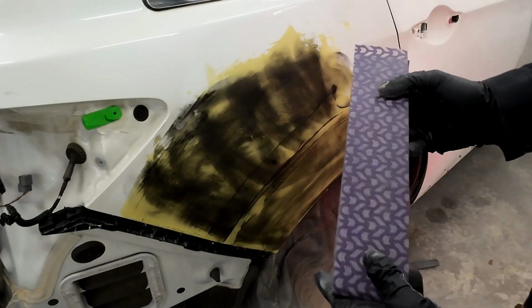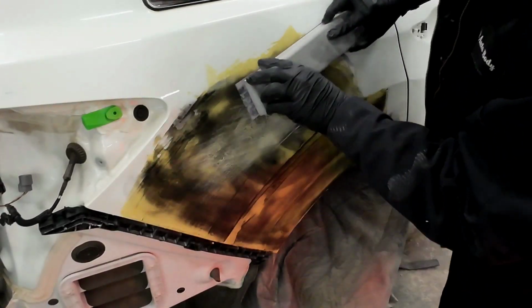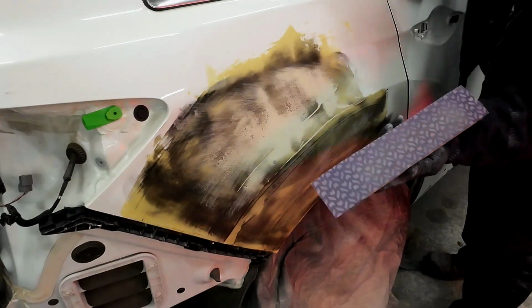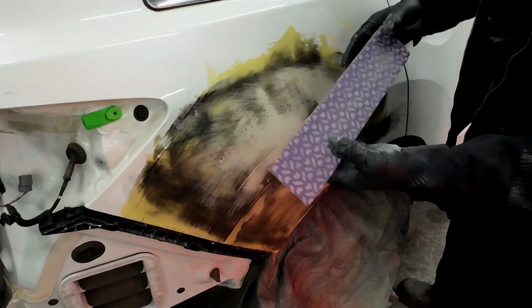Cost effective too, because even though it's a little bit more expensive, it's going to last a heck of a lot longer. I like to shape with 80 grit. You could shape with 36 grit. It's a coarser paper. It's going to cut it quicker, but it leaves very deep scratches that you have to remove. So my progression is 80 grit, 180, 320, 600.